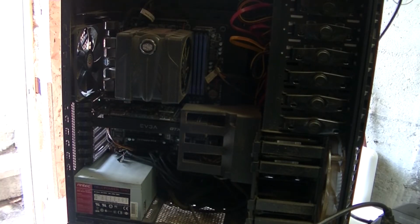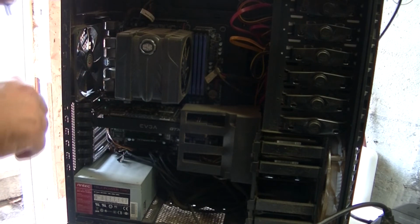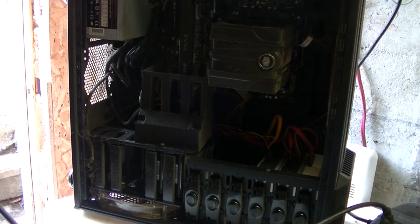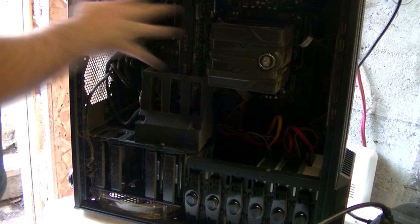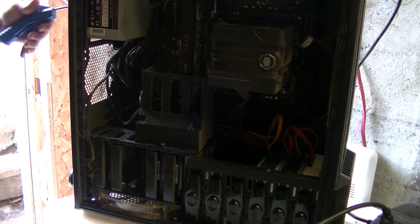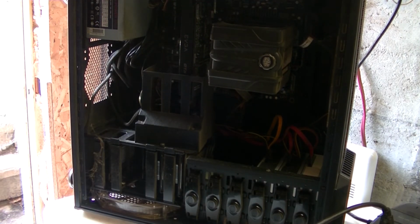Ew. Well, before I start doing the time lapse, power supply's at the bottom, so now we're going to be doing something a little extra different. So what we're going to do with this one is, again, bring it down right away. So now you want to stir things up from the bottom, because the power supply at the top's not a big deal, but at the bottom dust rises and it'll tend to go and jam itself here. So a little quick shot. Under the case it's inaccessible, so by doing it like this, dust flew everywhere, and that's what we don't want in our case, but that's what we want in general, so we can get rid of everything from here on up. So now that this is done, it's time for our time lapse.